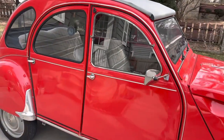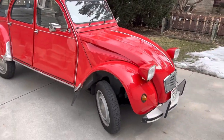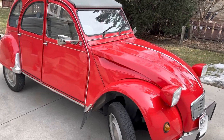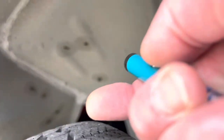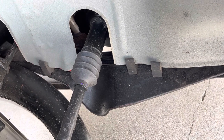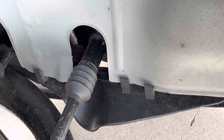When I first got it I couldn't get the paperwork for another week or two, so I spent quite some time looking at it in detail. I went around my block driving in the winter — it was kind of cold but I needed to drive it. I started to see a couple things that needed to be addressed. I could see some grease, and looking at the axle right here, there was a crack in this boot and it was throwing grease everywhere.